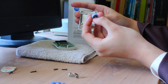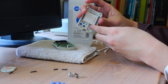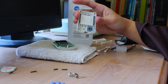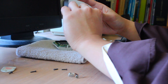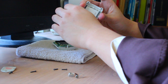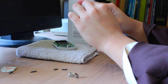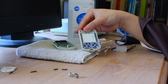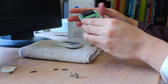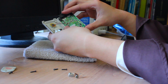Take your little D-pad — you see these little notches on the side? They basically match up with the little notches on the front part of the VMU cover. Just put it in like that. Then simply put the rubber padding back on. This is the first time I've ever done something like this on camera, so forgive me if I mess up occasionally, but that's okay. You just assemble it back like this, and then I love to take the PCB board of the VMU and just gently put it back on there — try to make it pop into place.